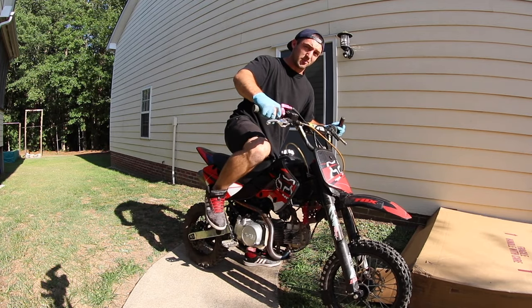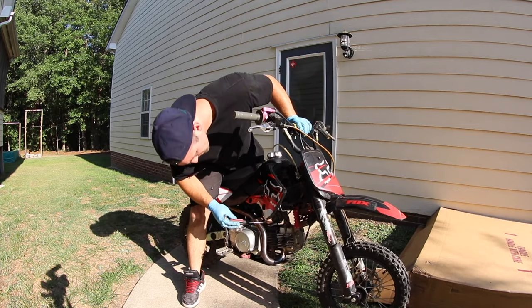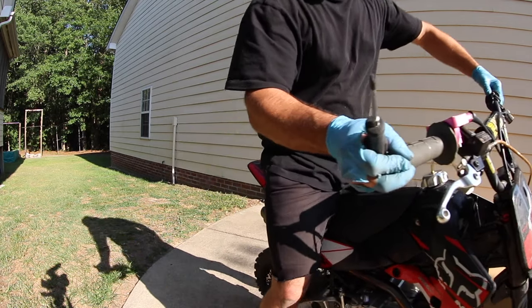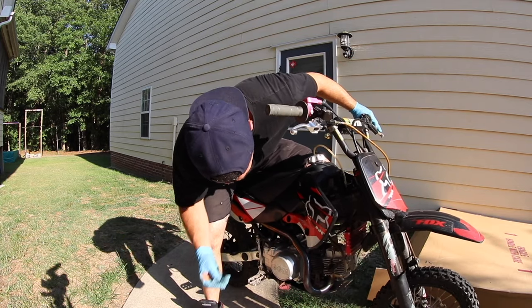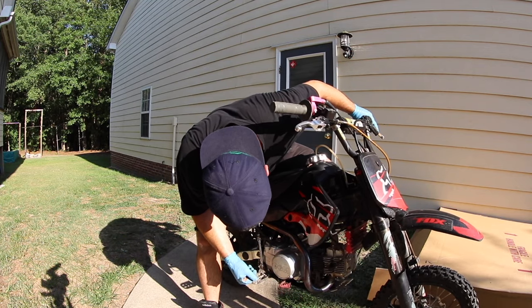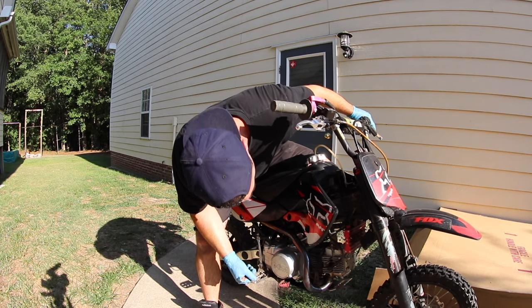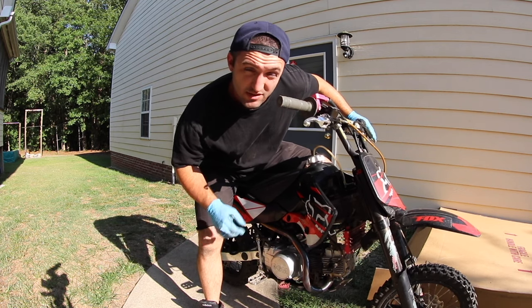These little motors have a lot of compression. So it sounds insane. The idle is super high. No matter what I do with the fuel or the idle screw, nothing really changes. It's dripping some fuel out on the kick plate or skid plate, and just overall, it sounds like it's got a vacuum leak. That's what I think it is. Air's getting to it from somewhere else.